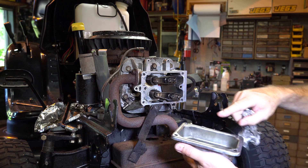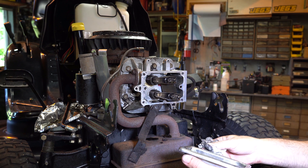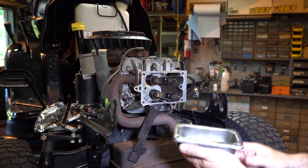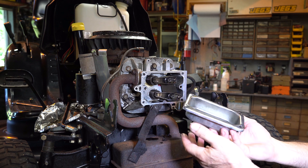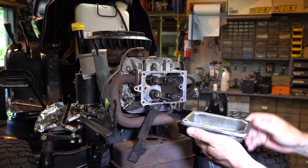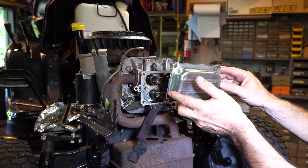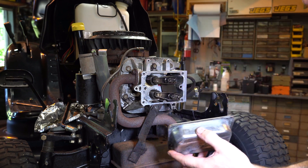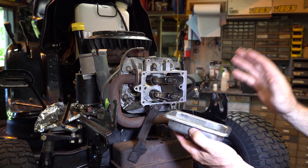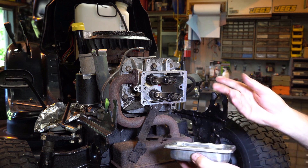We're going to lay a light bead down with my finger and then set it to dry for about a half hour or more. It's got to skin up — when it starts to skin, that becomes your gasket. When you put the cover on, you don't over-tighten it; you snug it. Best thing to do is come back the next day and tighten it a little bit more. This guy had it over-tightened — don't be this guy.